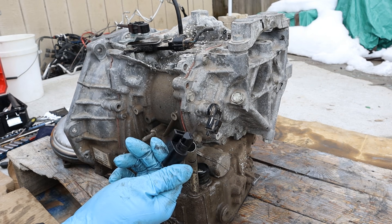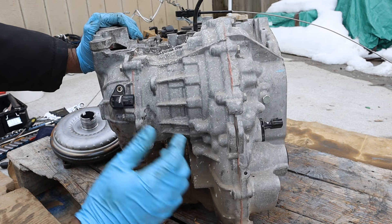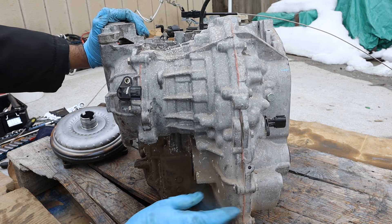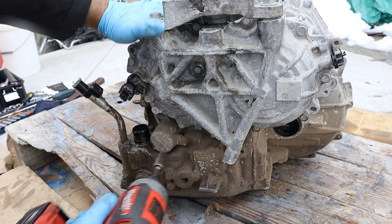There's also this tiny little dipstick — it's more like a fluid plug. Spinning this around, we've got our secondary speed sensor and then the final drive speed sensor. The differential is housed inside of here, and we've got our two output shafts that go to the front wheels.